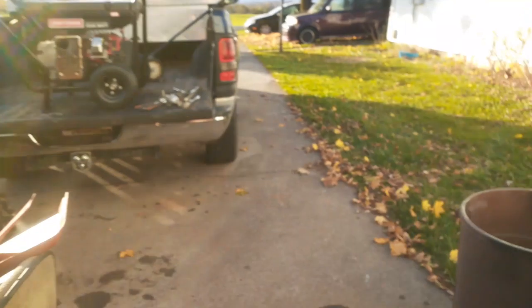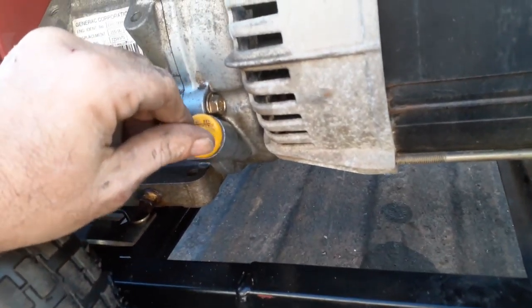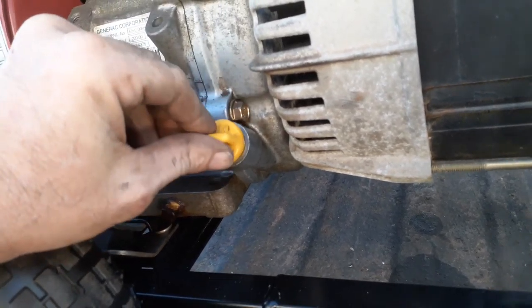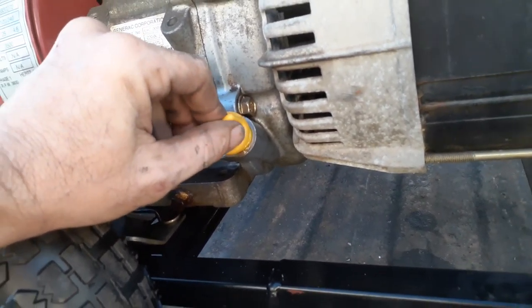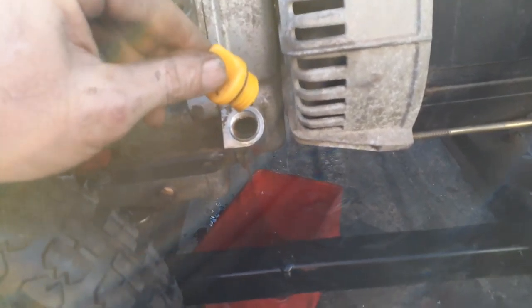All right, let's go out here and check this — see if we fixed it. When we did this fork, oil and gas was coming out and it still might be, I don't know. It's still full but it's running better. Let's see if we can get something to catch it. It might need a set of rings but it is running good — it ain't backfiring out through the carburetor. Yep, there's still gas going down in there, guys.